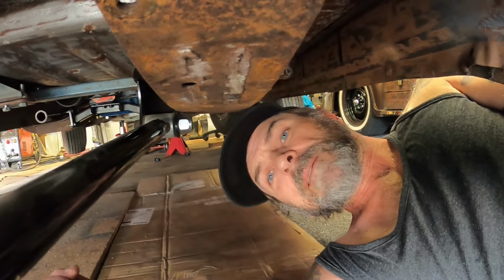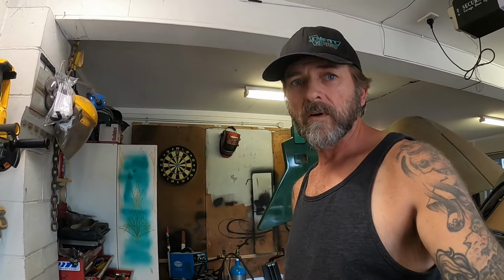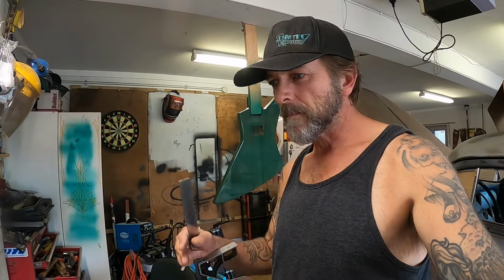Okay, so a simple way of making little collars for the handbrake cable, sort of stopper point, whatever you want to call it, is how I did it last time, was just with a bit of pipe, tube, with the same inside diameter as the outside diameter of that collar thing. Fortunately I still got a piece that's going to fit, so just going to cut me a couple of pieces of that, then I'll cut slots down them, and then I have to make up some kind of little tabs that I can then mount onto the area 51.